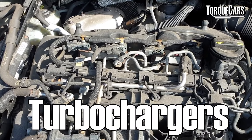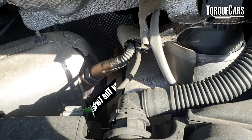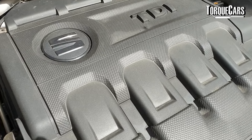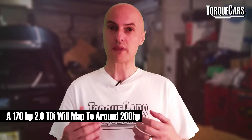After a remap, you need to start thinking about turbos — dumping more air into the engine to burn more diesel. Most people with a 140 will swap in a 170 turbo, as they're readily available from breakers' yards and give a fairly instant power hike. If you get it mapped correctly, you can take it to really decent power levels. Starting with a 170 bhp engine, a remap can easily take that to 200–225 bhp — a decent hike — but beyond that you need to look at upgrading the turbo.